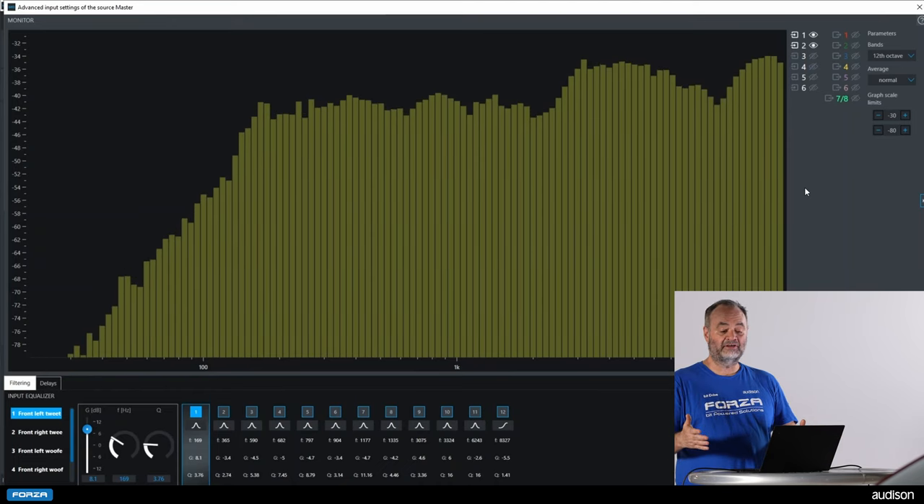I am going to enable channel 8. After doing that, I'll go into channel 7 and tell it that we are bridging 7 and 8. When I do that, it will sum 7 and 8 together and give me a single slider to control the signal levels for both channels 7 and 8. We have already verified all speaker connections, so we won't repeat that here.